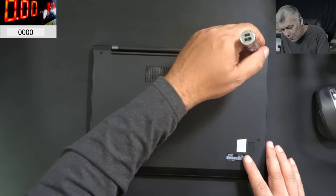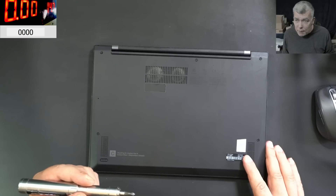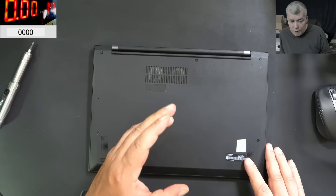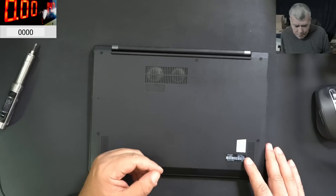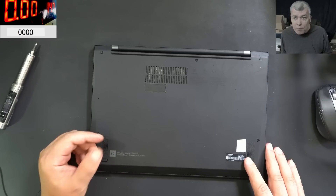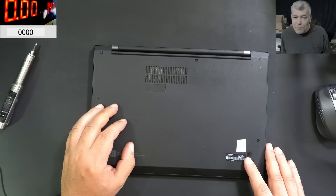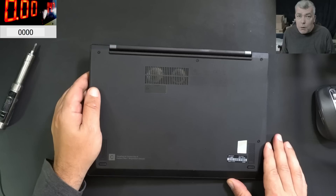When you are getting jobs like the customer wants the USB ports to be replaced — a specific job — your decision is the last decision. It is important what the customer wants, but you will be deciding if you're going to replace the ports or not. We have a genuine charging port here. If the ports are good and only need to be resoldered, that's what we're going to do. But if you order and replace the ports, you replace a genuine port with a copy port, because most likely that's what you can buy from the internet — it will be your responsibility and your warranty. Most of the time I choose to use the genuine port.